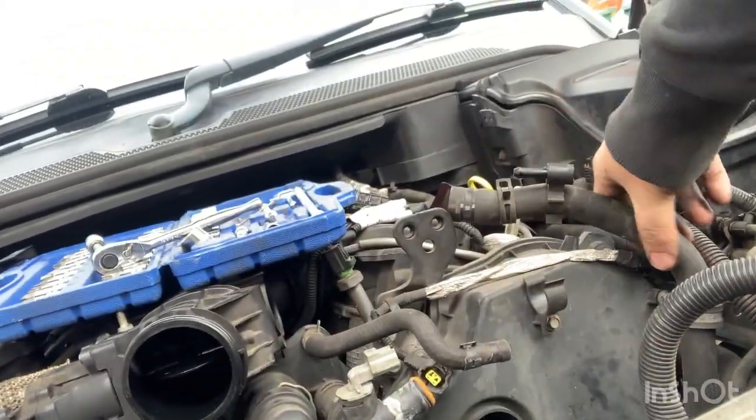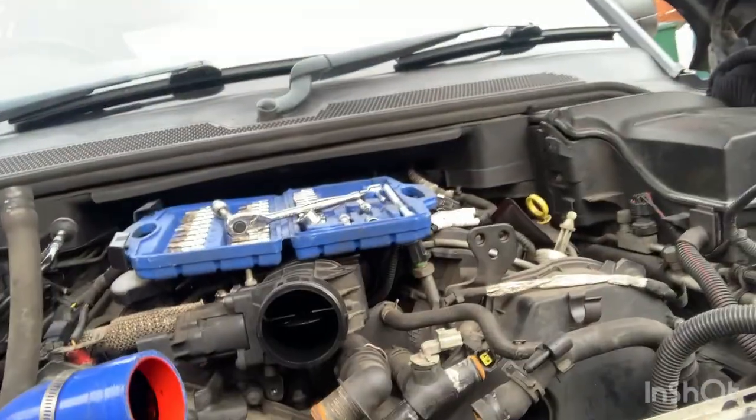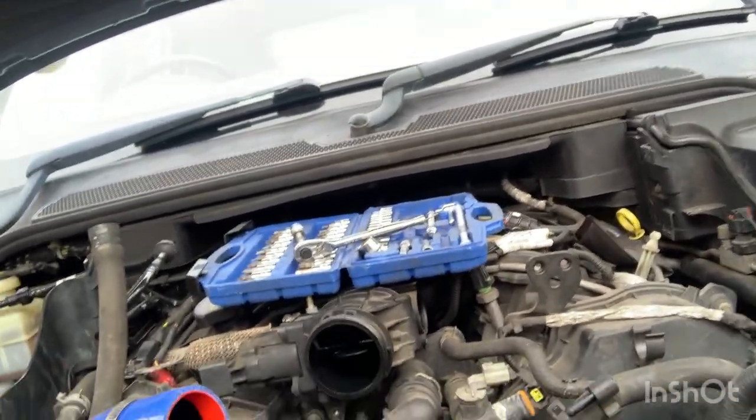And with the crank pulley, I got a larger socket on the actual crankshaft end. Found some hard material to push against and used my breaker bar, which doesn't have any ratchet or anything. And then I managed to break all 6 bolts going round and get that off. Like I said, I made that look a lot harder than it needed to be. But we're now at this stage where nearly all the clearance for the timing cover is off. I'll just start taking the last bits off, and I'll see if I can get the timing cover off that way, and then I'm going to worry about the butterfly on the top.